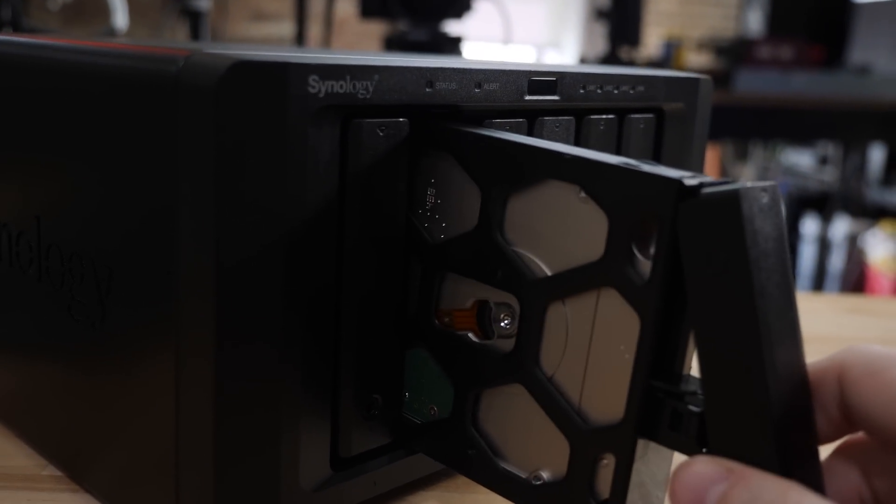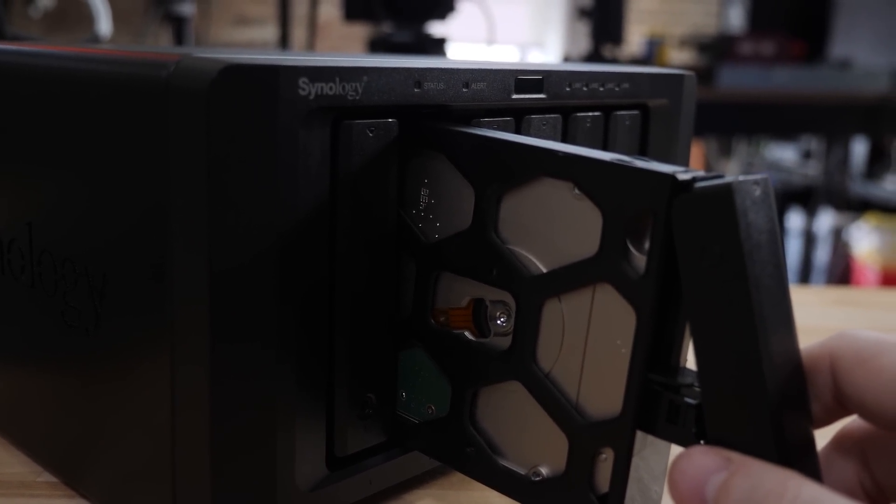Because this is the 2U2-node system, I've only updated three out of my six GPUs. In a real-world scenario, these two nodes could be part of a VMware cluster, assuming your witness is running somewhere else — it could even run on a Synology NAS, not recommended but it works. You'll want to finish all this on one node, then migrate your virtual machines from the other node to this one, which will be back to running VMware in just a moment. Then you'll be able to update the other node — that's how it normally works. You migrate everything off the host, then boot from USB to update the firmware. That's resiliency and solid VMware engineering architecture.